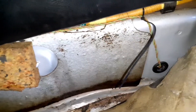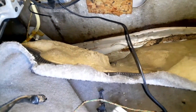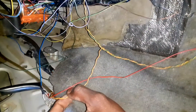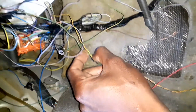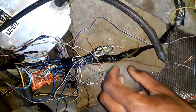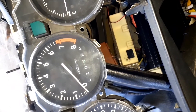I fitted everything at the bottom, and those are the three wires from the three pins coming all the way from there. I marked them from the bottom. This is ground, and it's been connected there - it just needs reinforcing, tying nicely, and insulating. This is ignition, which is connected to the key-on, and it has to be fused.